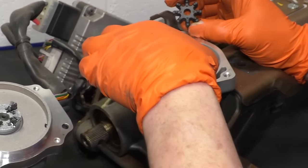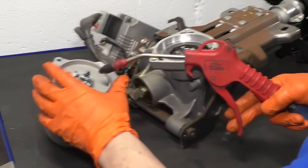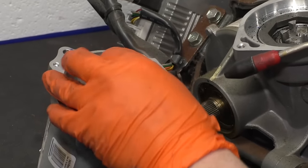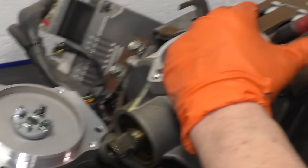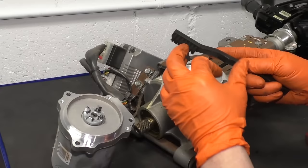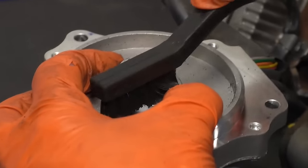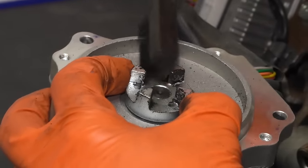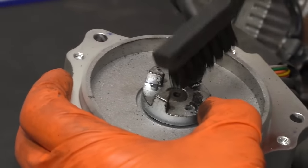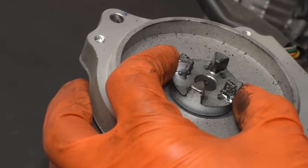Here's the new one and here's the old one — very common issue with this vehicle. With shop air, I'm just going to blow the plastic particles out. What doesn't come out I'm going to wipe down with a clean brush — not a wire brush — because this is an electrical motor and you want to do minimal damage. You might have to take a pocket screwdriver to get some of the heavy particles off. I would not recommend spraying any sort of chemical directly on there.